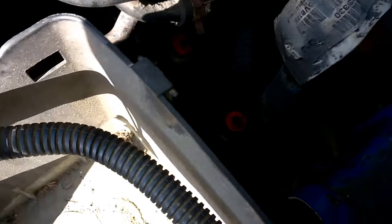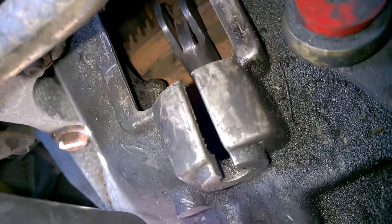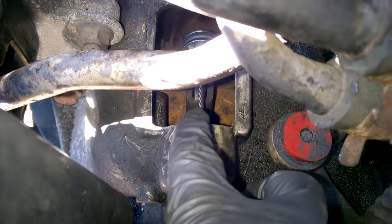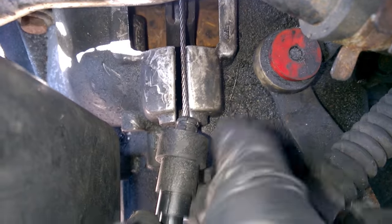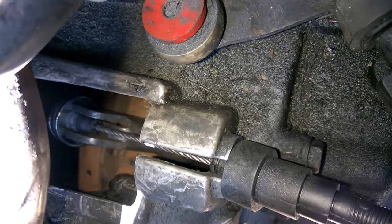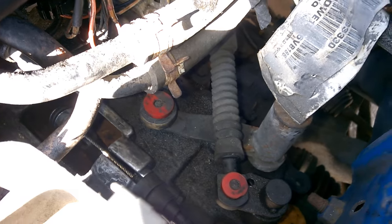Next step: we've got to take the end of the cable and put it into the fork in the transmission. We've got to slot the cable through that slit and put the end disc into the fork at the very top. This is what killed me on the aftermarket cable — hopefully it'll work better this time. We're so close — the cable's put through the slot and the discs are at the end of the fork. I pulled the spring back as much as I can. I'm going to take the plastic end of a screwdriver and just tap that so I can get the rubber end to fit into its slot. Beautiful — we're all set. Cable's in place, slotted into the fork fine. Clutch pedal feels great. Now all we have to do is button things up. Thanks for watching — I hope this helps with your own clutch cable issues. And always: don't go with cheap aftermarket cables.